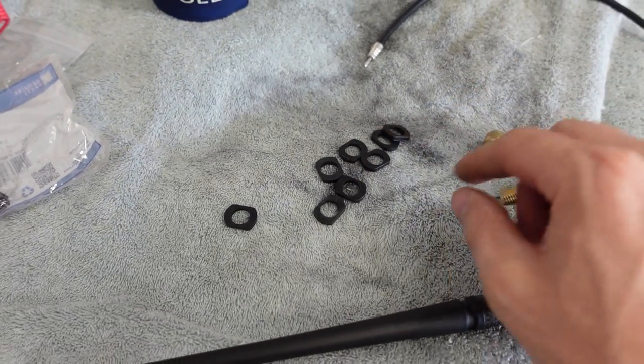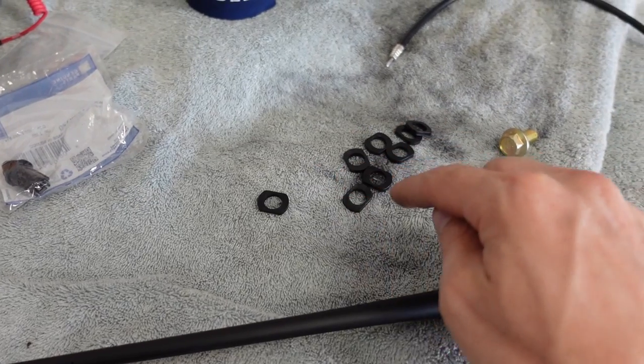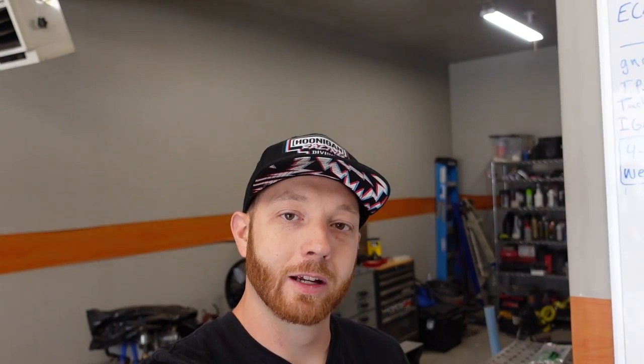I don't know what these do yet, but these spacers are what is going to fix the problem we have with the seat clunking back and forth. I showed you this whenever we took the first test drive of the truck, but basically there's a spot in the power adjusters that wears out. I think there's normally like a spring or something in there, but anyhow, it falls apart, and whenever you hit the brakes, the seat clunks ahead, and when you hit the gas, the seat clunks towards the back. Really, really annoying, really frustrating.